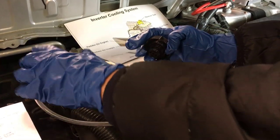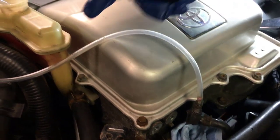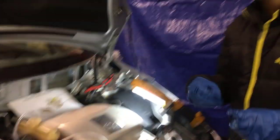The way this works: all the air bubbles are going to come out of this opening along with the coolant. As they come out and into the reservoir, the air bubbles will escape but the coolant will remain in the reservoir. As that cycle continues, only coolant will be left after a few cycles.